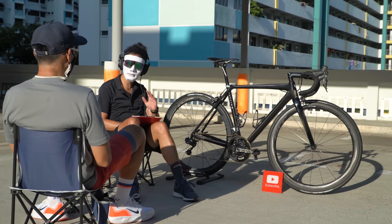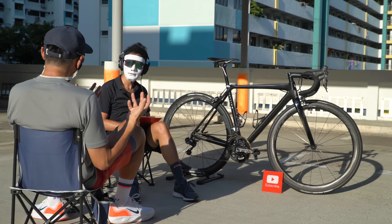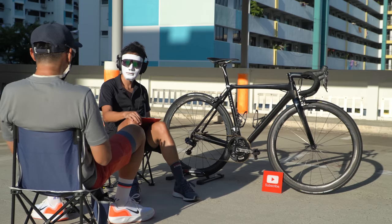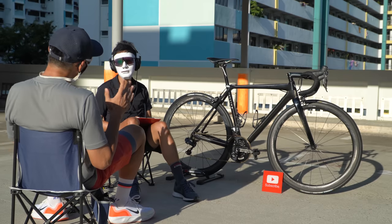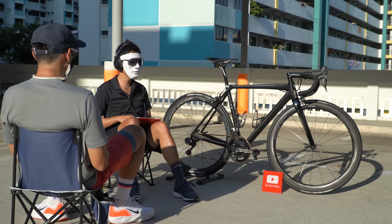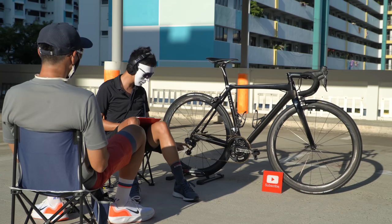Will it break the hanger or will it bend the hanger? Derailleur will give first? The best thing is the hanger will bend. If the hanger bends, just change it. But if you break a derailleur, break a chain, the consequences tend to be a little bit more severe. Right. Oh, okay. I never knew that. I just know that bigger cassette, bigger chain. The cog usually needs a bigger, longer cage.